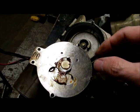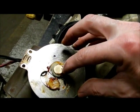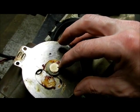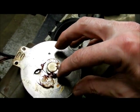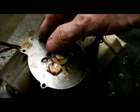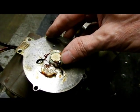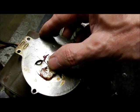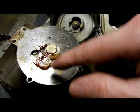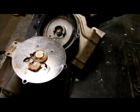It's kind of clever. When going in the forward direction, the pieces don't catch. But when the motor has reversed and goes to park, the cam will come up and catch — and you can see it just flipped the switch. Motor turns off, and your wipers have stopped.